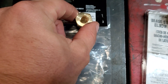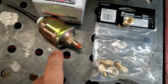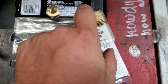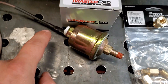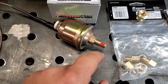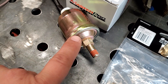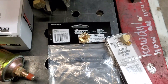You're going to screw the adapter inside the block first — it comes with a little crush washer, use it. Do not use any Teflon tape or anything like that, because the oil sending unit needs to be grounded and this is how it grounds itself to the block. Then screw on your 45-degree elbow — again, no tape. Then screw on your single-wire oil sending unit. I've already got a wire on mine, heat shrinked. That wire runs straight to my oil gauge on the dash. The reason you need the elbow is that without it, this edge right here will hit your valley pan bolt and won't let it screw all the way in. Kick it sideways just a little bit and you'll be able to use it.